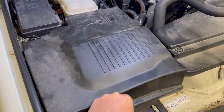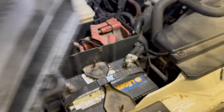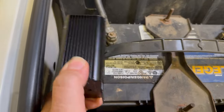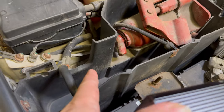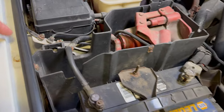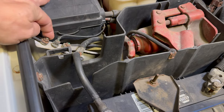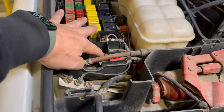The battery for the Land Rover Discovery is underneath this battery cover. There's plenty of room for this device to sit here next to the battery, or even here in the jack box — that's where I think I'm going to put this. This vehicle has a nice grounding bar right here where I can pull my ground off of, and if we open up the fuse box, we have a nice connection for our positive here as well.